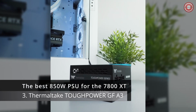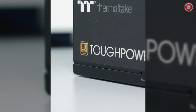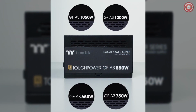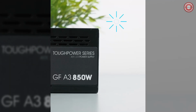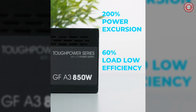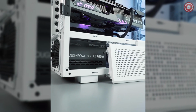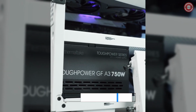This is the Thermaltake Toughpower GF A3 power supply. These 80 Plus Gold rated fully modular power supplies come in 5 different wattage variants and are Intel ATX 3.0 certified. This means it supports 200% power excursion, reaches 60% low load efficiency, and complies with strict required power supply timing standards. In English, that means with one of these in your system, you'll be saying, "That's some stable power right there."